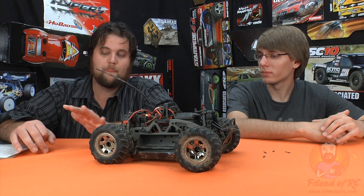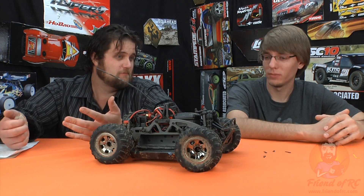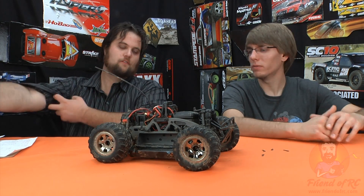On the other hand, the steering servo was horrible. I'll give it a pass because even the Stampede 4x4 that we love has an underpowered servo, but this one was exceedingly underpowered. Right out of the box, turning the front tires was getting hung up — I had to break it in for about 10–15 minutes before it would turn consistently. That might be part of it too.